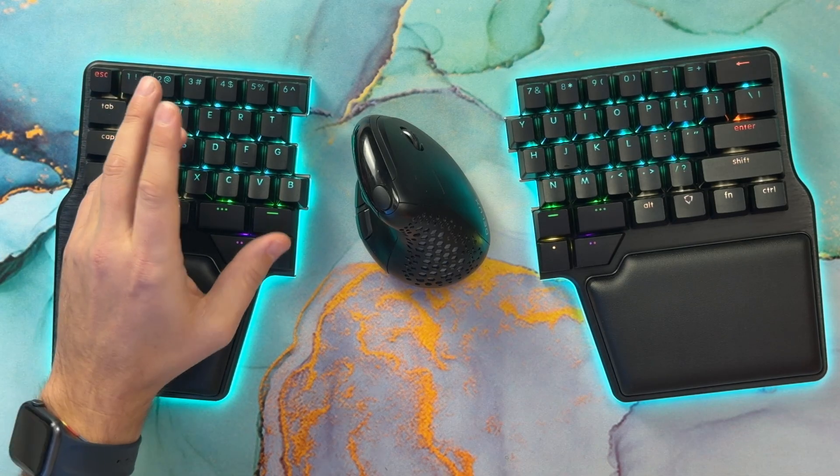Overlap Threshold lets you roll your keys without triggering the hold function. That means pressing another key won't immediately trigger the hold function — there is some leeway to release the previous key. The higher the number, the bigger the leeway. Increase this setting if you're accidentally activating the modifier; lower it if you're not getting it when you want to. The default value is 80, but if you're going to use home row modifiers, I recommend setting this to 100.